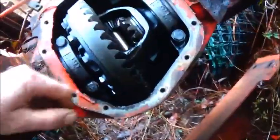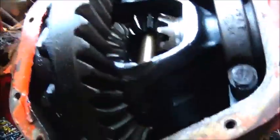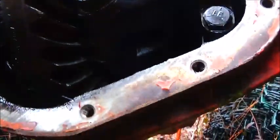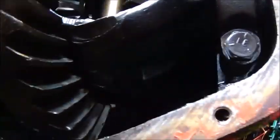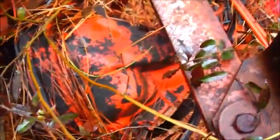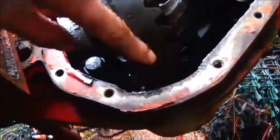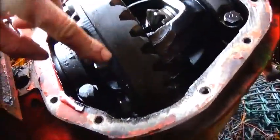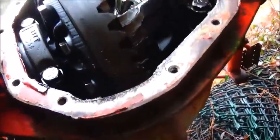Okay, just off of a quick inspection. First, of course, it's not a posi unit, which I didn't figure it was going to be. Second, I don't know what ate in that thing, but boy oh boy, at one time something pretty major happened in there. But it's not a big deal because I've got another one right here. But I want to see what gear, and we're close. Matter of fact, 37.6. That may be what we're looking for.